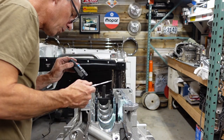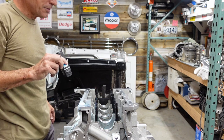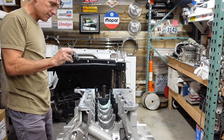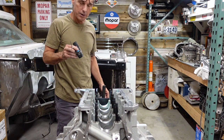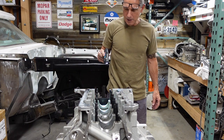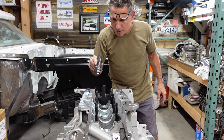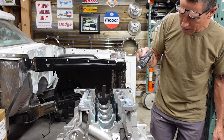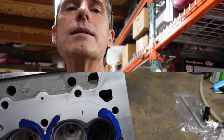The only reason why I ever wanted to build a 588 is because everybody has 572s. And I'm like, well, I'll just take a 4.5-inch crank that you would normally use in a 572, and I'll just have it offset ground out to 4 5/8, build a 588. All right, let's see what that looks like.